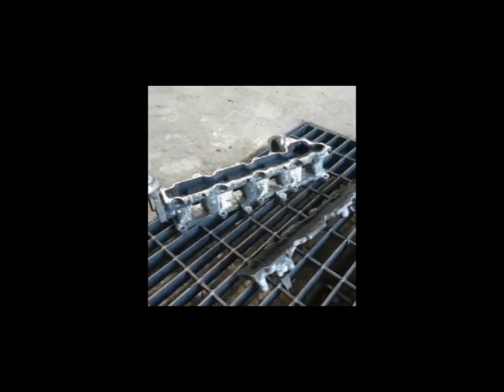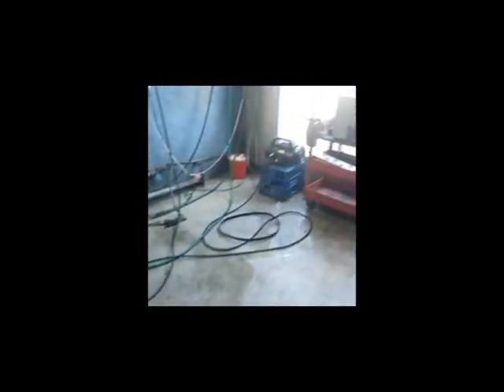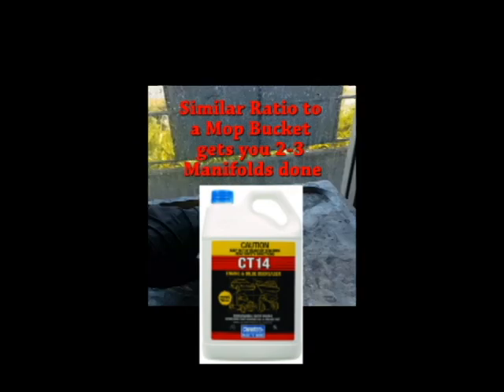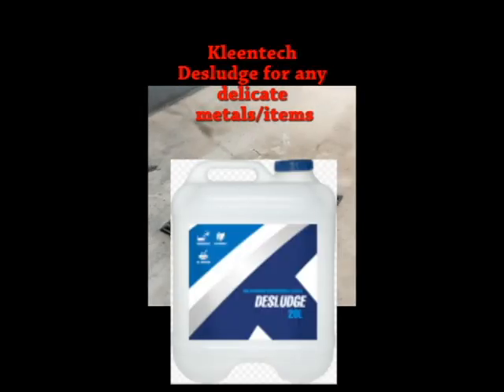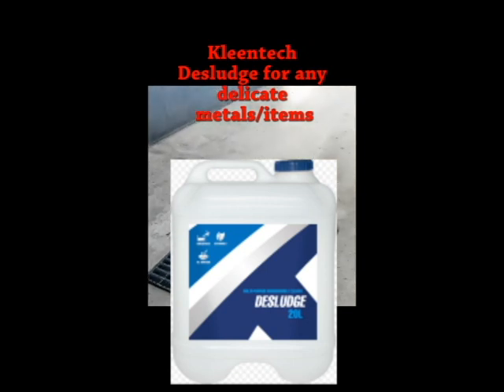So what are we going to do about it? Just a quick five-minute scrape with a screwdriver works best for me before I put them in the ultrasonic tank. A lot of people are starting to get on board with these — so that's the model it is. I turned the temperature up to about 70 degrees when I started the job, it's almost there, so we're just going to dunk it in for a good half an hour while I go and have some lunch, leaving the tank to do its job. I'll then probably give it another gurney and usually another 15 minutes after that.